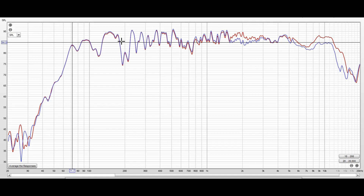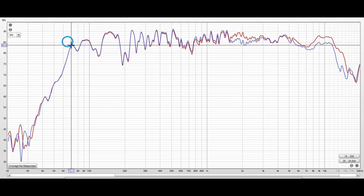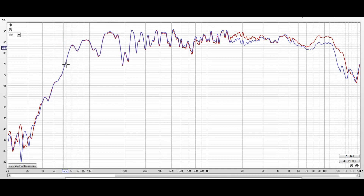It's down a bit in some areas and up in others, but averaging it out I'd call it around 85 dB SPL. Looking at the low end, we're at about 70 Hz here, and if we go down 10 dB to about 75 dB SPL, that's about 62 Hz. So this speaker doesn't give much bass energy below 62 Hz. Both speakers are measuring pretty close to one another with only minor deviations.